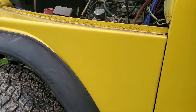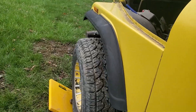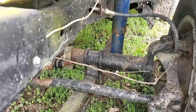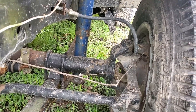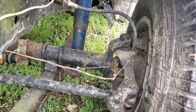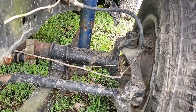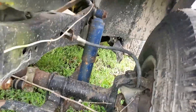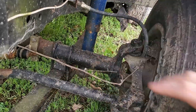So we come back up here. If you go a little further or we start having tire movement, when somebody else is doing that, you would be able to watch for that slack in the tie rod ends and watch for that movement up in here. The same thing goes with all wheel components. If you need to check anything to do with your steering or your suspension, lift the vehicle up. Well, first check it on the ground because the tire has tension on it. Have somebody inside turning it back and forth while you go down the component looking at all the pieces. Then with suspension, lift it up a little bit — push your wheel left and right, push your wheel forward and back, rotate everything, steer back and forth, and you're going to be able to see if there's slop in the joint or wherever you have issues going on.